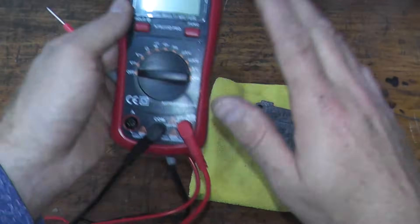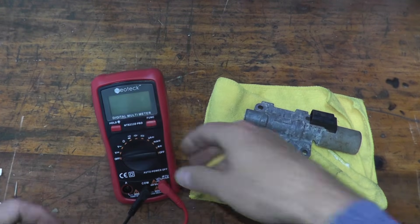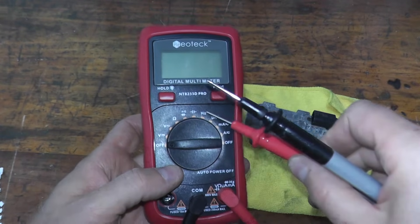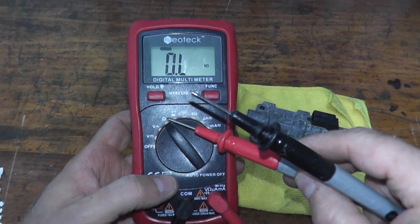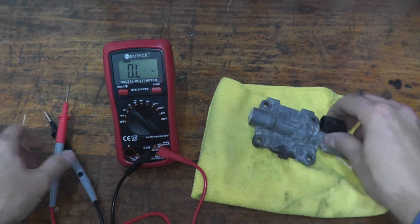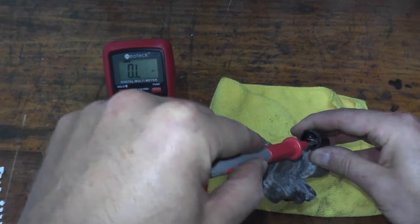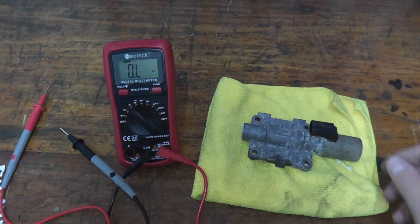The first thing we'll do is an ohms or resistance test. For that you need a digital multimeter — this one I purchased off Amazon, does a terrific job, was inexpensive. I'll include a link in the description box below. On the meter, the symbol we need is the Omega symbol — that is for resistance or ohms. The multimeter has two leads, a black and a red. The sensor has two prongs. All we're doing is taking one lead to the left pin and the other lead to the right pin. It does not matter which lead touches which pin.